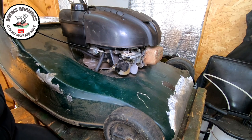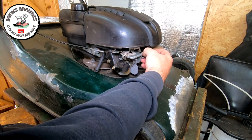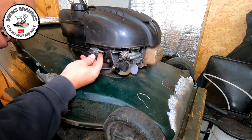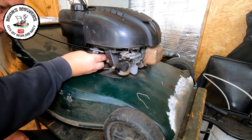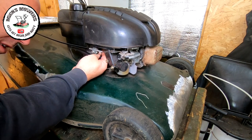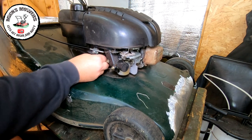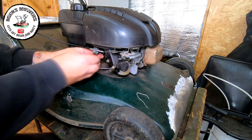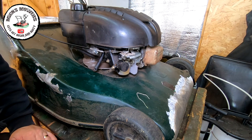We're going to take it back outside and see if we can get the machine to fire now. I'll put the HT lead back on and try and get it to fire up. The crankcase breather pipe's got to go back on as well — that pipe seems very very long to me, it's got a kink in it, which would be another reason why it's not running right. It's not right — I'll go and sort that out in a bit but let's try and get it to fire first.